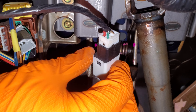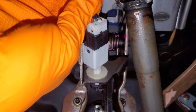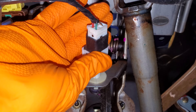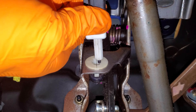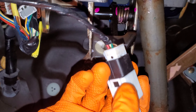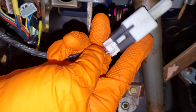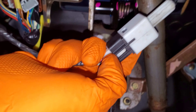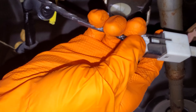As far as removing this, we can disconnect it — not a big deal. There's a four-pin connector on the back. To remove the body of the switch, you just grab it, rotate it counterclockwise, and pull it back. This is your actual switch here, and to disconnect it you push on that tab there — that's going to free up the switch. Kind of hard to do one-handed, but you get the idea.